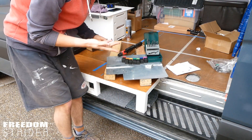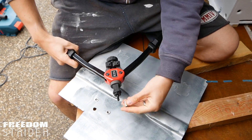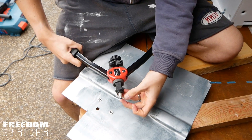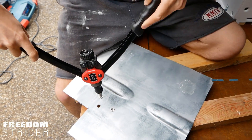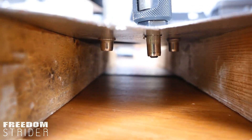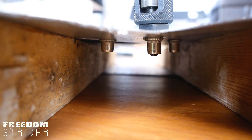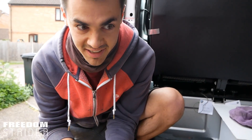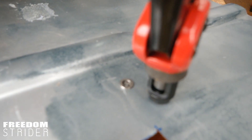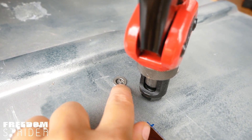It might be a good idea to drill a smaller pilot hole first. With the hole drilled, you need to open the tool up all the way, then thread on the rivnut and place it in the hole all the way down so it's flush. Once it's flush, all you do is squeeze the tool. When squeezing it will be tight, but if it's excessively tight then stop — we accidentally broke one of the heads by squeezing too tightly, which means it's not in properly.